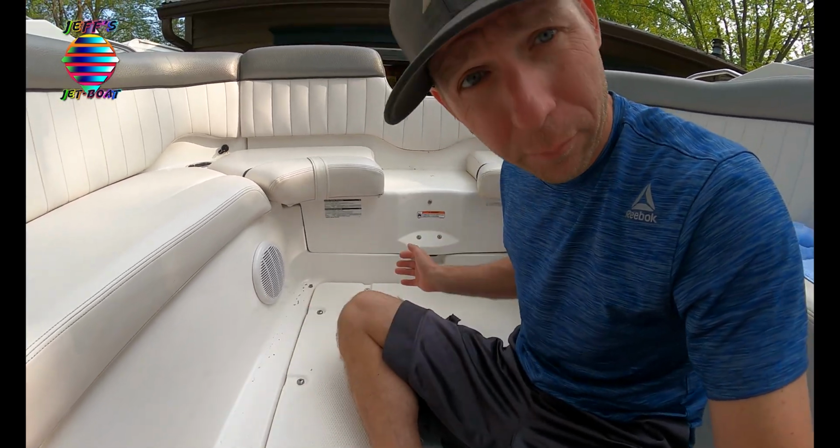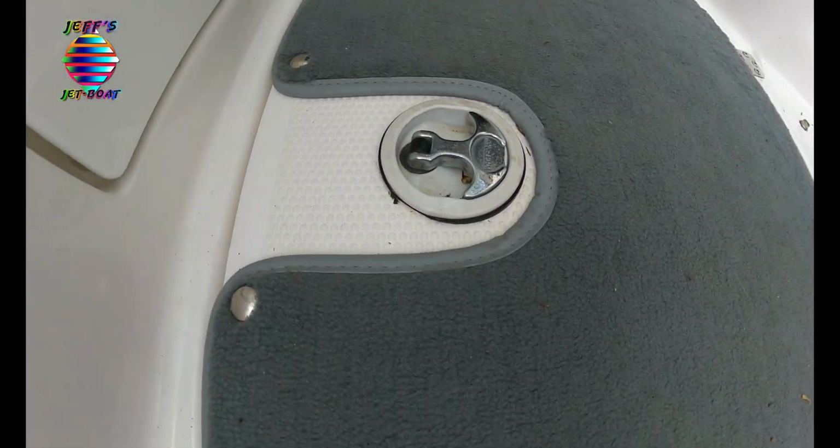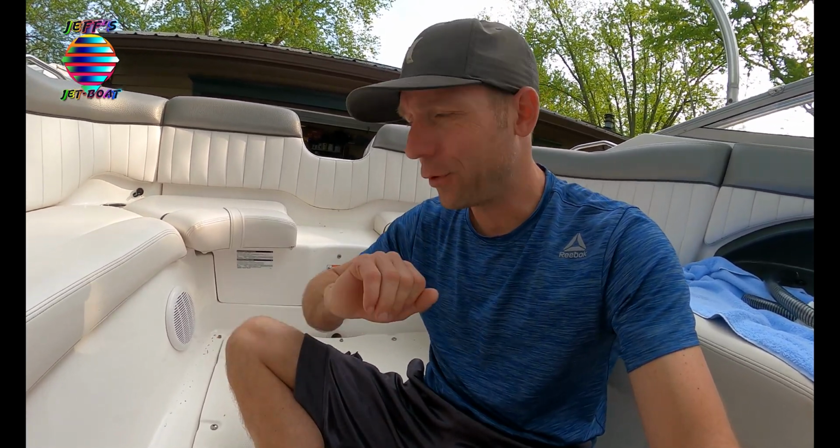There is a ton of bolts. This hatch ain't gonna go anywhere. You break 6 of them, it's still not going anywhere. You know, they redesigned this and they use latches, kind of like that right there. It's how they did it in the 240 series, probably because of these problems. So if you're gonna remove it and it feels like it's gonna break, just let it break. That is your best option. If you want to go from there and drill it out and all that, by all means go for it.